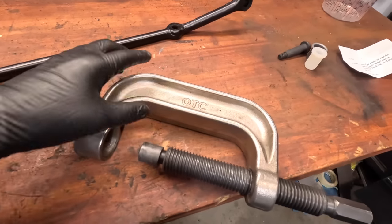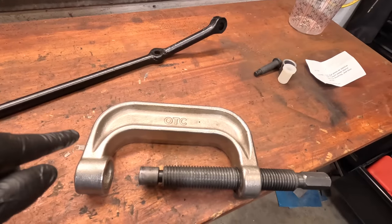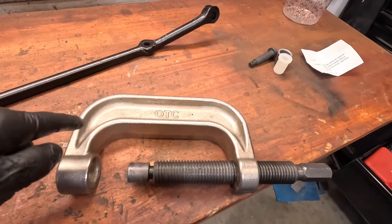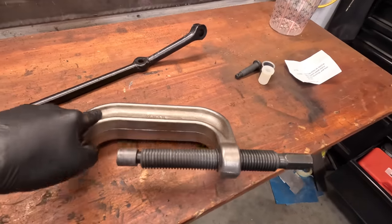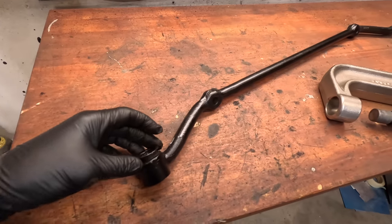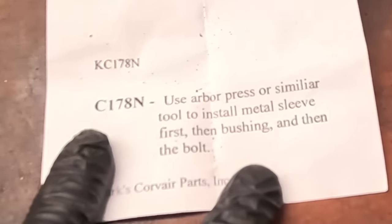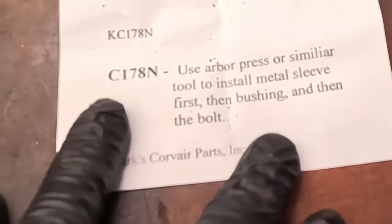And we're gonna press out the original one here. I'm gonna use my OTC ball joint press, which I absolutely love this thing. If you're in the market for something like this, I highly recommend it. So I'll drop a link in the description where I got it. But we should just be able to press this one out, and looking at the instructions, it just says, press it out, put in the metal sleeve, then the bushing, then the bolt. So it looks pretty straightforward to me.